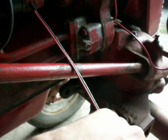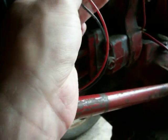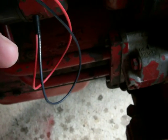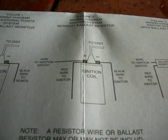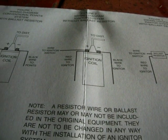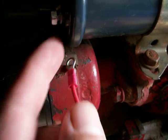We have those two cables that run outside with crimped-on ends — I left a generous amount of wire on here. Once we attach to the coil, we'll have a nice drip loop. I like drip loops so that if you get water, it doesn't run into the electrical device. Looking at our diagram, the black goes to the negative and red goes to the positive. The red wire goes to the same side as our starter wire — our on/off switch — and the black wire goes to the other side.